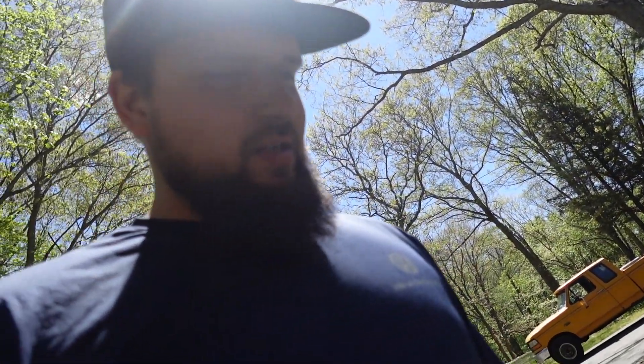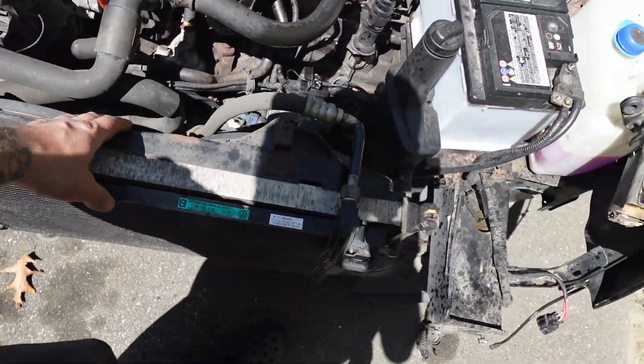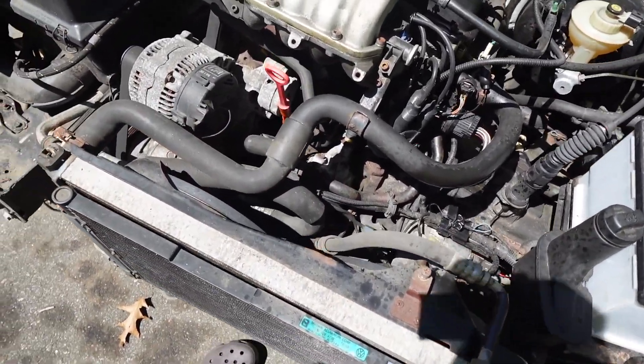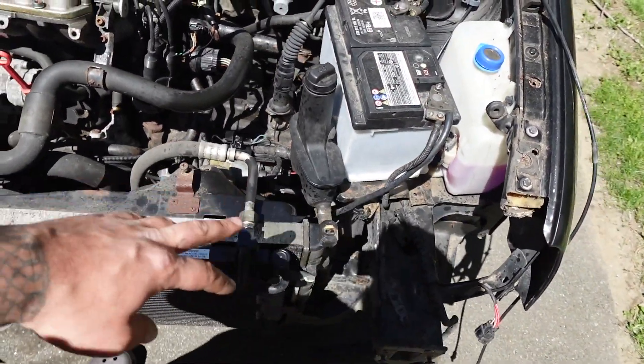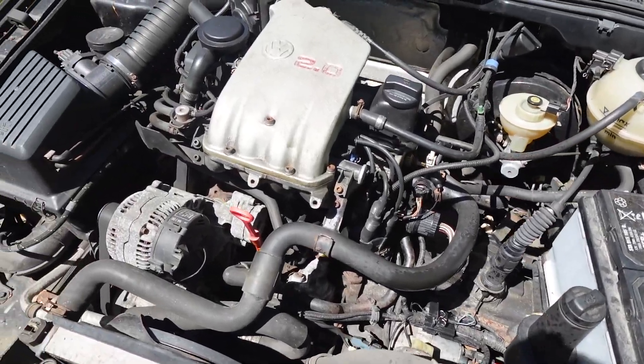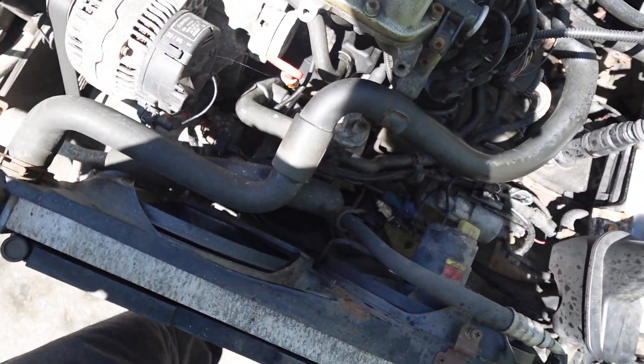I am not sure what I'm doing — never pulled one of these before — but figuring it out one bolt at a time. You know, keep going till the thing comes out. We're gonna have them suck the AC refrigerant out with the machine — you don't want to just let it go in the air because it kills the ozone layer. Then drain the coolant, get these coolant hoses off, there's a bottom AC line down there and another coolant hose at the bottom, and then that should come off.